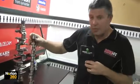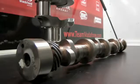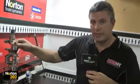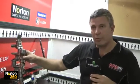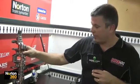The camshaft — these days we also use a control camshaft for V8 Supercars with 700 thou lift. This is one of the earlier ones, the 8620 — they've had a few versions of them now. It did knock the power around 12 to 15 horsepower, but most teams seem to have it back now. We don't seem to have any valve spring problems or rocker problems, and they've definitely done a good job in that area of the engine.